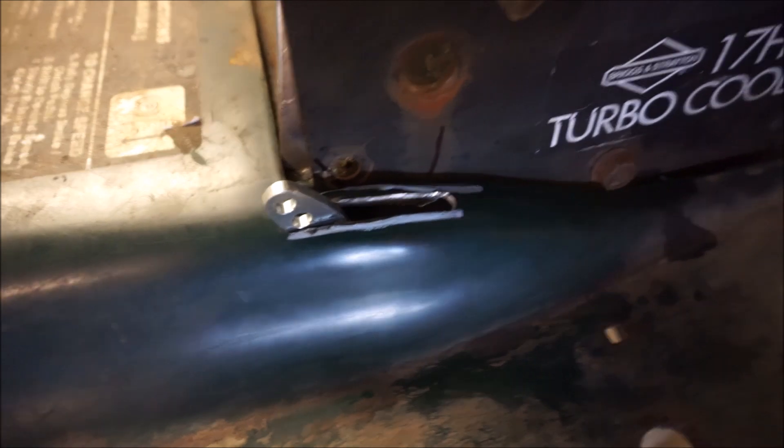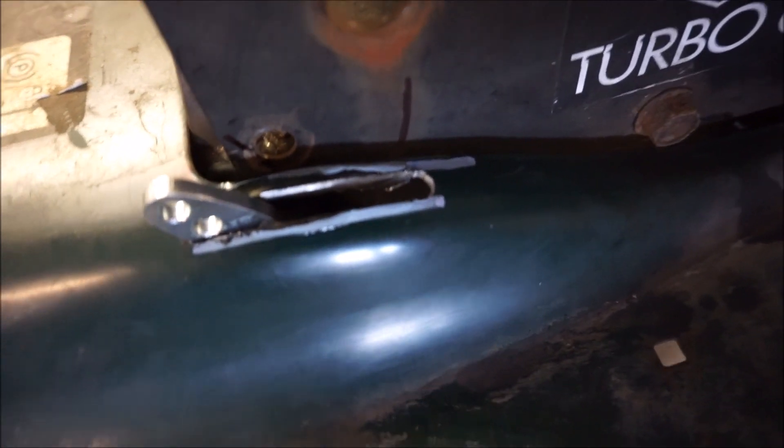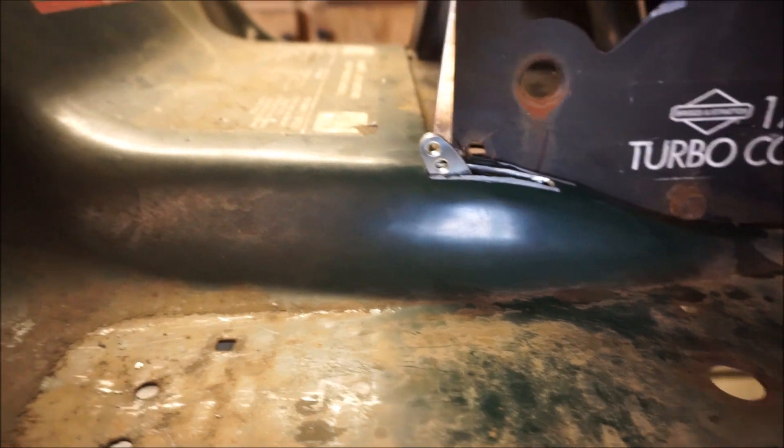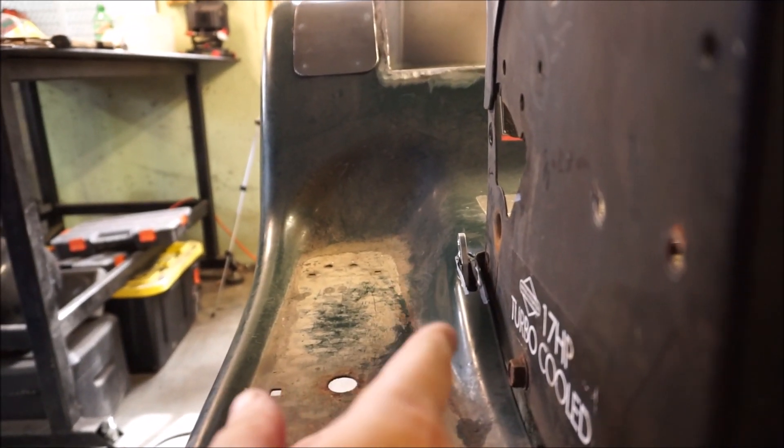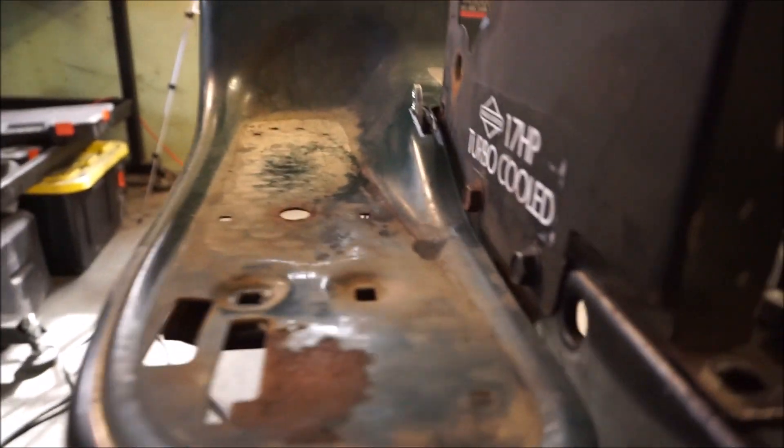I got the slot cut out — it was actually not too hard to lay out or cut, much smaller than I anticipated. The only problem is the master cylinder is going to be hitting the inside of the running board fender. The front of the running board has to come down about half an inch or maybe a little more. The contour of the fender is also pulling the whole running board and fender over to one side. I just have to relieve a little bit of area — worst case I'll cut a relief cut, pop it out, and weld it back up.